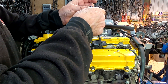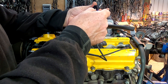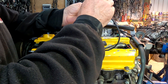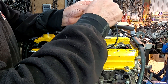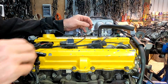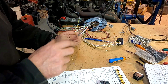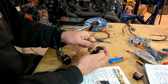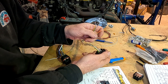Once we've got all the plugs on the coils — I do have the other side to do but I can probably get away and do that later — it's time to feed them into the ECU. If you're running an ECU with four drives then you need to group your coils. In this case, because I'm running a 2500, I've got eight drives so I can use all of them. I've already gone through and allocated the colors and matched all the colors up, which makes it much easier. In the B plug is ignition seven and eight, and in the A plug is the first six.